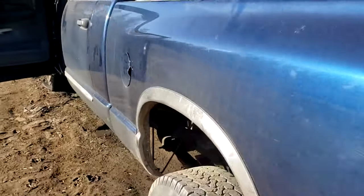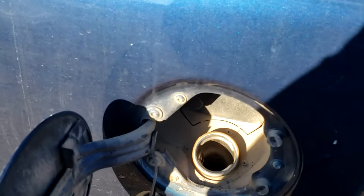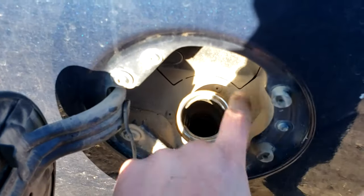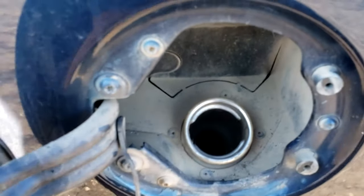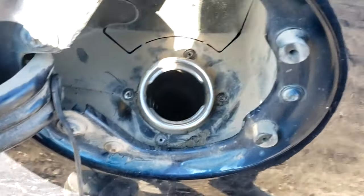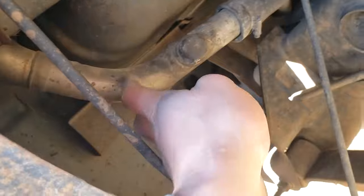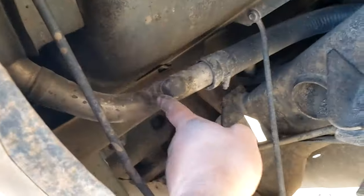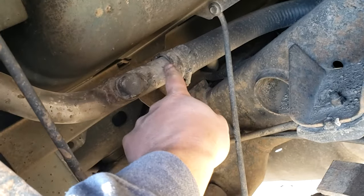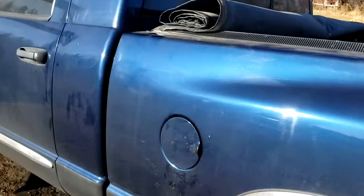Now that the bumper's off, we can take out the filler neck. On second gens there are four Phillips head screws, but these look like rivets so I ended up drilling them out. They've been giving me hell — I went through one but it still feels attached. Rather than monkey with it more, I'm going with plan B: I'll leave the filler neck with the box and just take the rubber hose off, removing the two hose clamps. I'll just leave the neck with the box — no big deal.